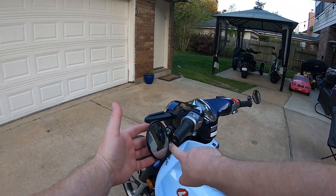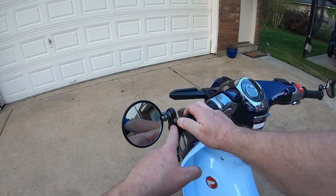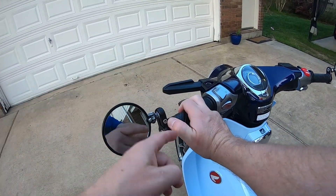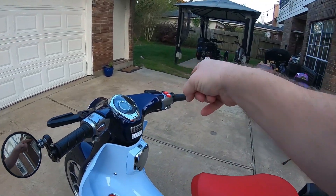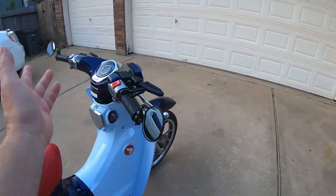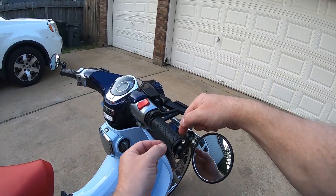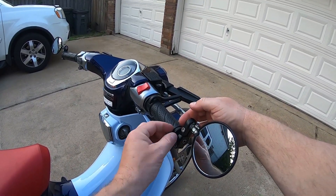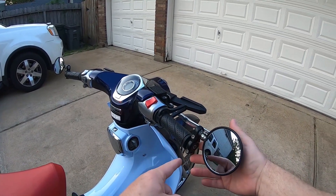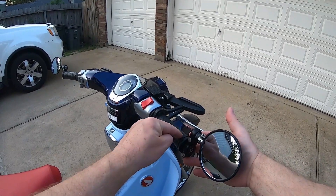While I'm standing here — I finished putting the CRG lane splitters on. The left side went on reasonably easy. I'll do the install video showing how I got in there and hit the releases. The throttle side was much more of a challenge. This side has a much deeper indent because of the throttle tube right here, and the throttle tube is not going to flex — it's actually covering the detent in the handlebar that holds the bar weight.